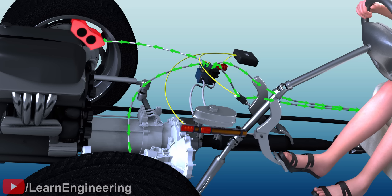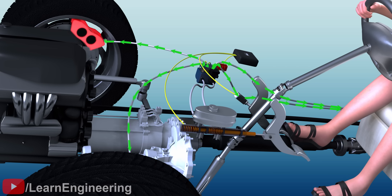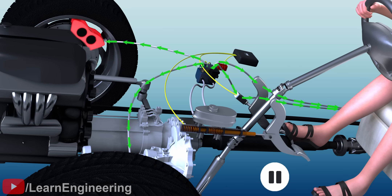Now things are easy. As soon as the driver releases his foot from the brake pedal, the HSA goes into action. Using electronic controllers, the HSA maintains the same pressure even when the foot is released. Now the driver presses the accelerator pedal. HSA detects the accelerator pedal pressing as well. At this time, the controller gives the order to gradually release the brake pressure.